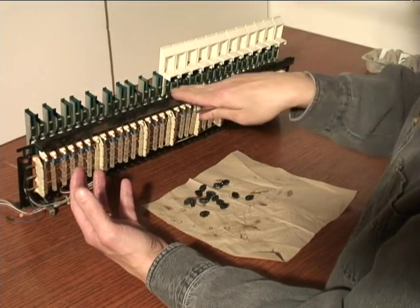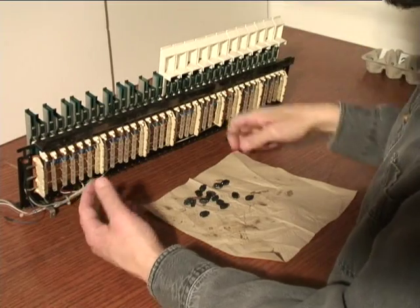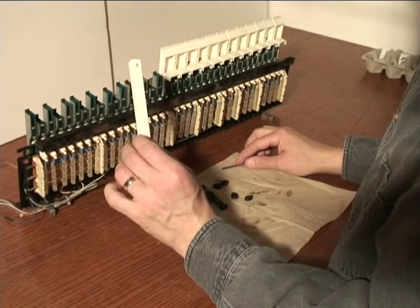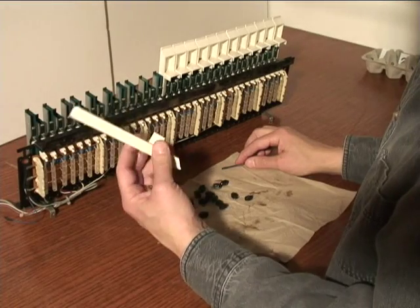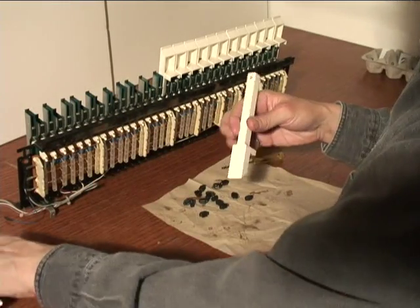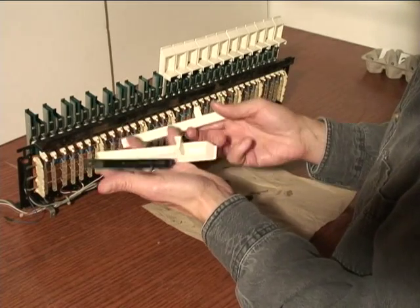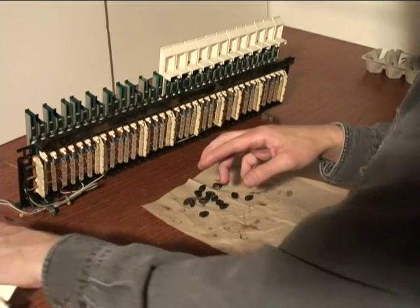Because it's such a mess, I'm going to have to clean this entire assembly with isopropyl alcohol after I remove all the keys and bushings, then put the new bushings in place and replace all the keys. Another tip: because you have all the keys removed, this is a good time to clean them. You can just put them in a bucket of warm soapy water, let them sit, rinse them off, and they should be as good as new.